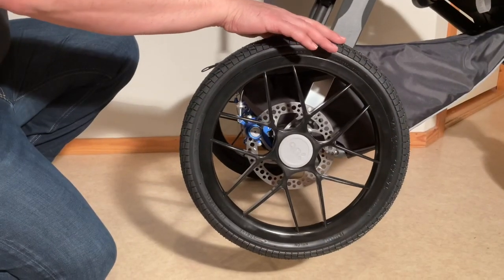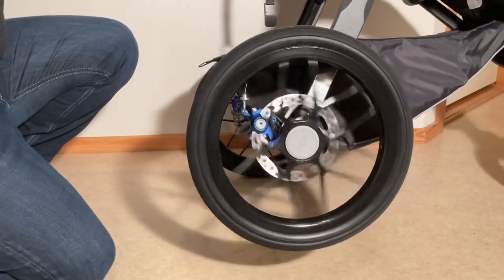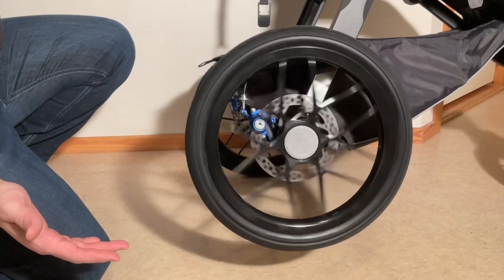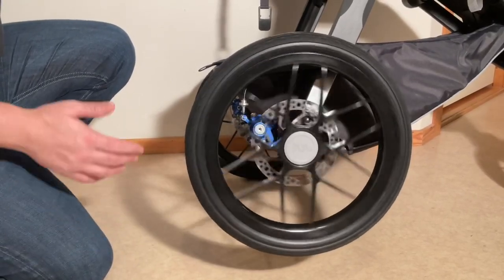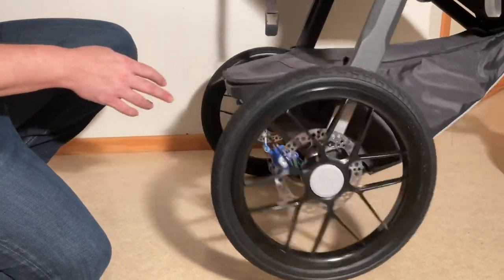So the sound would be something like this. It could be worse or less, and what this means is that the brakes are too tight — essentially on the dynamic handbrake — so the calipers are touching the brake disc.